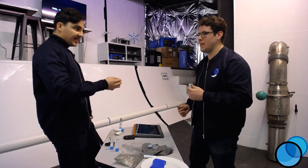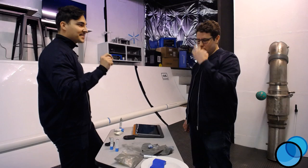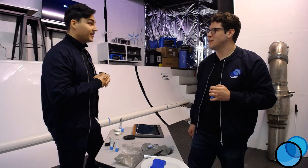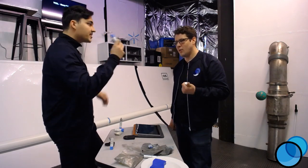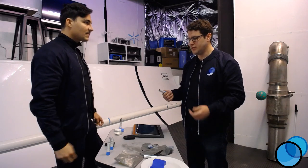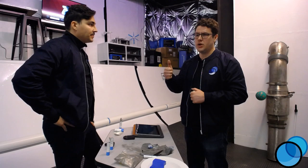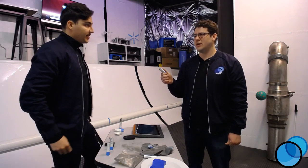It's not optimal in a car, but in terms of efficiency of storage, I'm not the science guy, but are metal hydrides more efficient at storing hydrogen, not calculating weight, but could they store more? That's a good question. I think so, but it all comes down to weight, right? It comes down to pros and cons. Exactly. Weight is one of the biggest factors in determining efficiency, especially with vehicles. This is too heavy to use on a large-scale car. That's why they use either liquid hydrogen storage or pressurized hydrogen storage. I believe the Mirai stores hydrogen at a pressure of around 8,000 PSI. Pretty high. Yeah, it's pretty high.